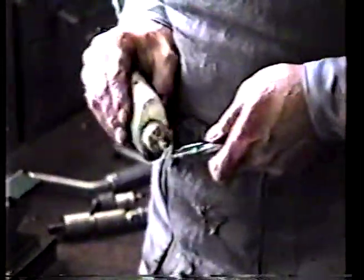We make all these fixtures ourselves, just to make sure that everything is perfectly straight. You see how this fits? There's no slop at all in it. First thing we're going to do is put some threads in here for our inserts. We use these time-serts — just about anybody can get them — they work real well. However, we do have one trick that we recommend.